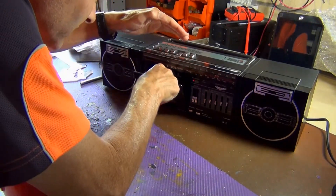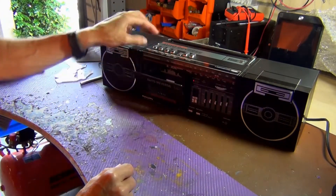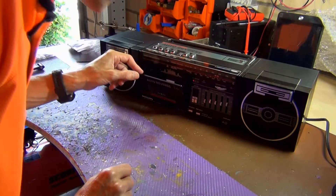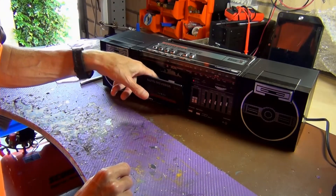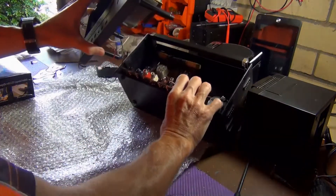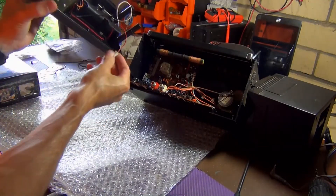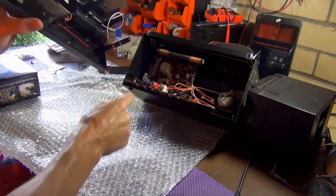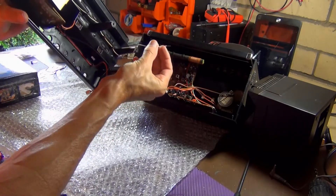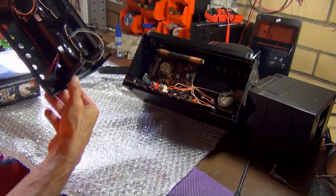The tape deck is not moving at all. I'm on tape mode and I'm not getting anything either. The tape deck looks in pretty good condition though — no dust, looks like it's had a nice clean out. So I'll remove all those screws and take this out very carefully. There's a little connector here that connects onto the circuit boards, so make sure to disconnect that. I can also see my aerial wire came off when I removed the panel.